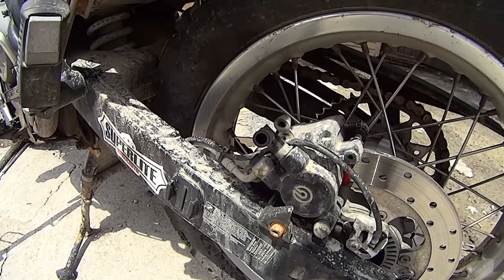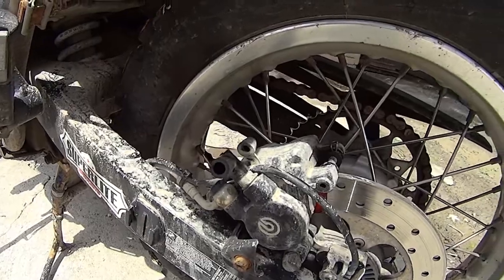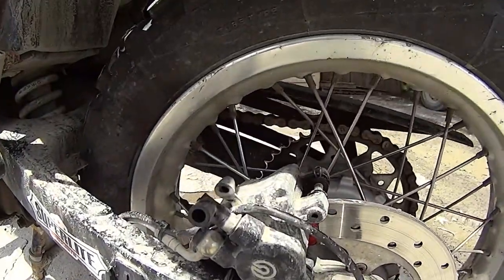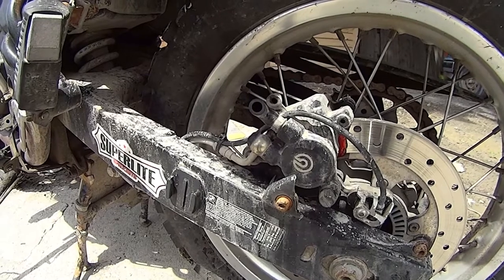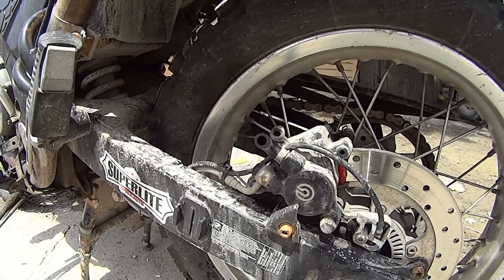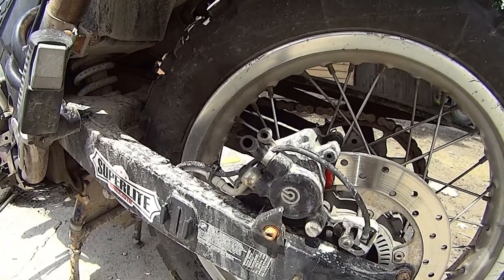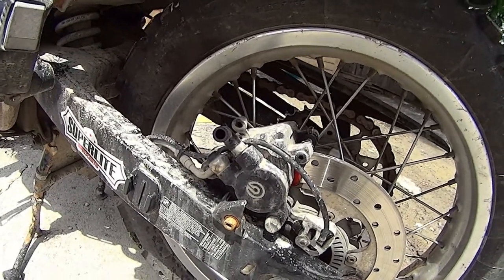Alrighty. I picked the smallest dealy whopper that hooks to this hose, and I've already pre-fitted. It's an 11mm wrench to release the brake fluid thing, the bleeder valve. So now I'm going to hook this in, and then we go from there.